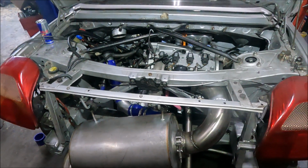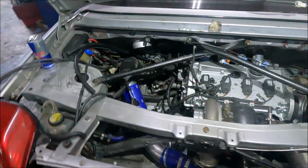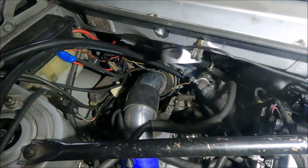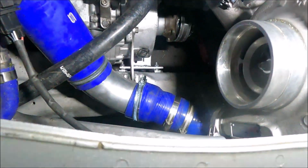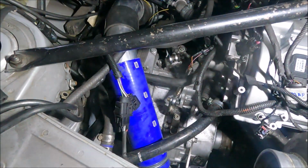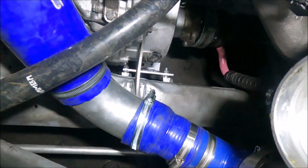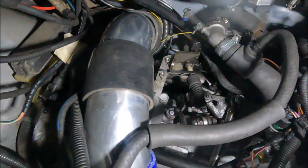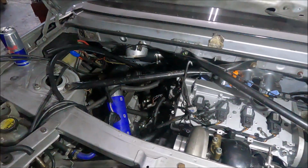So while I'm not gonna get it started this weekend because of the lack of oil feed, don't mean I can't get on with other, well, probably bigger jobs. That is the boost pipe run complete, from where it goes through into the car to the compressor outlet. That bit is actual silicone hose, so it's got a bit of flex, but nearly all the rest is metal, butted up to metal, and the hose is just joiners. To be honest, it makes no difference.